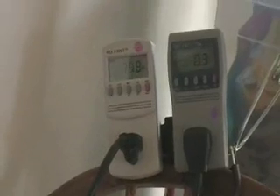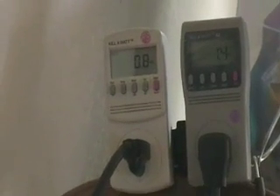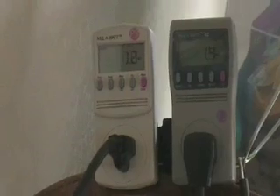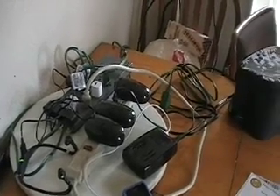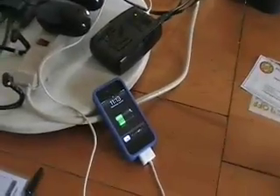Now back into the kitchen. You can see that the fridge just turned on and then just turned off — it actually ran for quite a bit longer than that, I had to turn on the camera and get it all ready. You'll see it was up around 380 watts, which is a good amount of draw. Right now this is all running off my 500 continuous watt inverter with no monitor or meter. I'm just testing it with one battery back on. It went up, USB turns on, and there goes the phone charging. We're good.